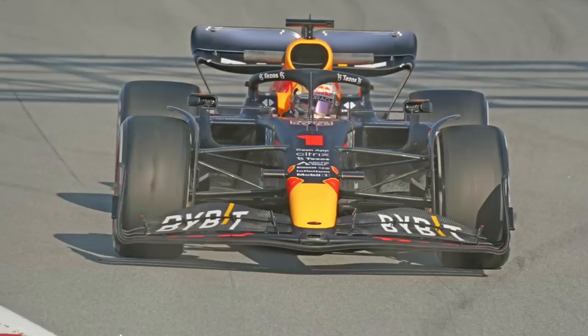My suspicion for this is that it's predominantly for mechanical reasons. All the cars are running very different rake and overall ride height setups compared to last year. It makes sense that some teams will be playing around with their suspension geometry to achieve a good compromise between ride and aero platform control. With this particular wishbone geometry they're likely playing around with their anti characteristics — perhaps trying to help their pitch control under braking — but without knowing the pickup point locations we can't get exact numbers on that.